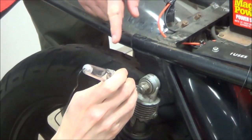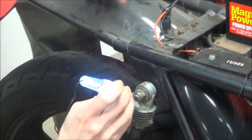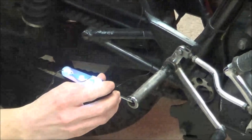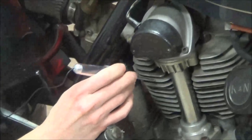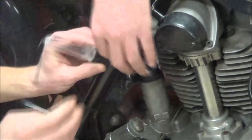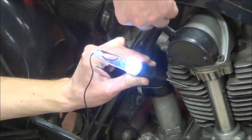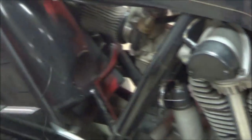Not such a great ground right there, is it? The rubber dampener, the rust on the bolts or something — he can finally find a spot that has one. Let's just try even like the foot peg. So we got pretty good grounds on this. Let's try the engine, because we always know the ignition system grounds. The ignition system will ground through the engine, which is bolted to the frame, which the ground wire is bolted to. So we're looking for all those paths. I'm feeling pretty good about that.